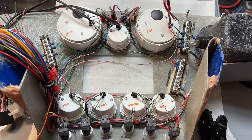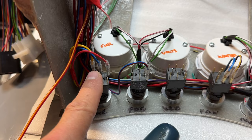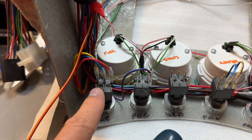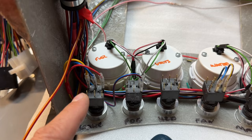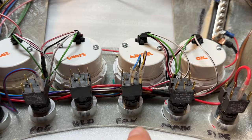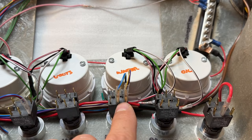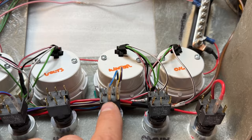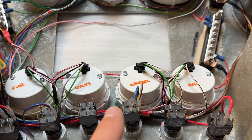Still doing the easy wins. For the handbrake switch I've put the cables in — I know I had a different way around on my previous car and just had to try different combinations. I'm pretty sure I took a picture of the correct combination and this is it. The fan is only two-speed since we're not using the black-yellow, so I'm on the right pins there. I'm doing the easy wins before tackling the wires that need little jumpers on the Savage switches — they're very small terminals.